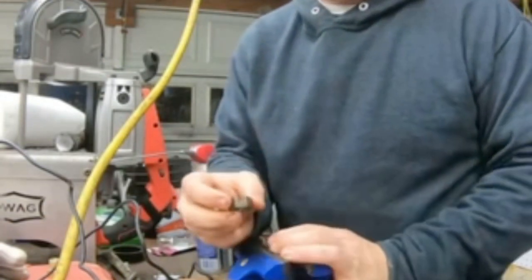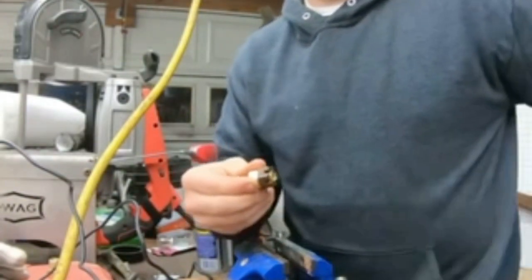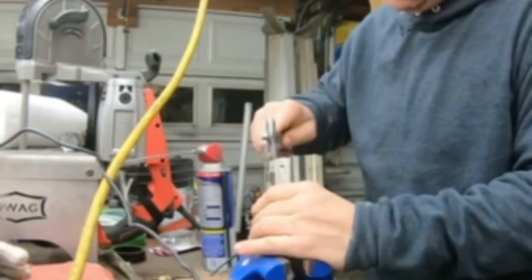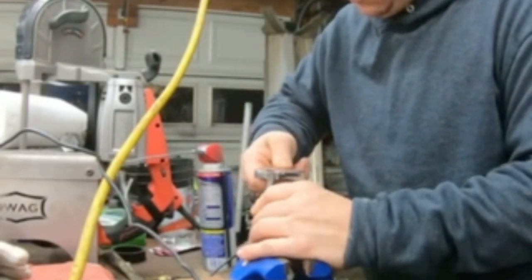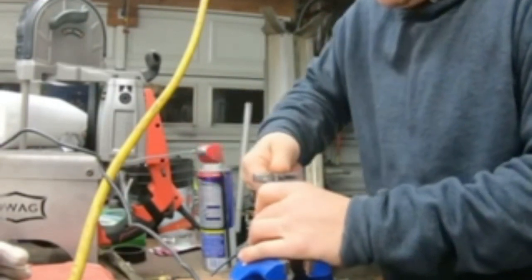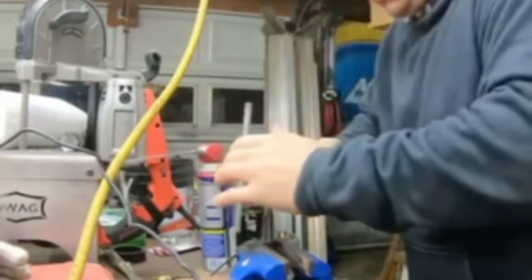And I had an old, looked like a ball joint nut, that I had in my little throwaway cabinet. Bam, there we go. So I'm going to try to tap this, or thread it rather, sorry. I hope this really works, because I'd much rather just tack in place one of these instead of doing the other route. I know some would say to just drop your pan and all that good stuff. Don't want to do that. And I got the stuff here to do it, so I might as well try it. That's one thing I just want to try to make happen. There it goes, it started.